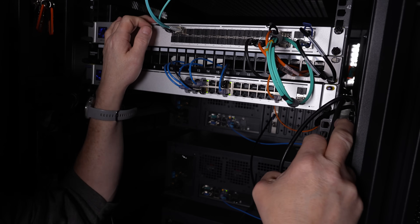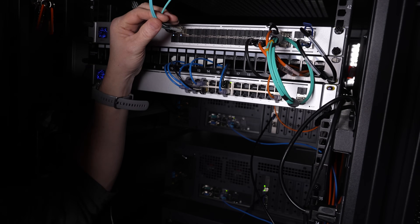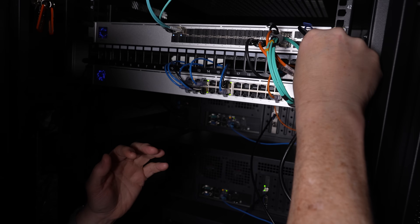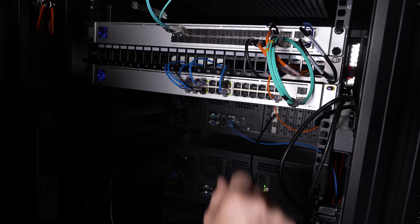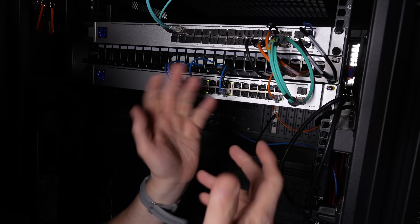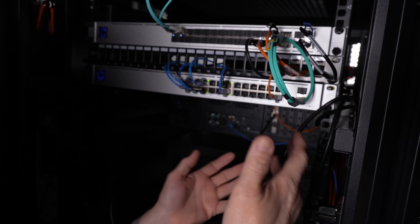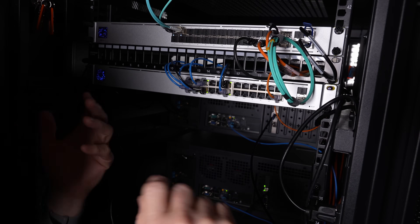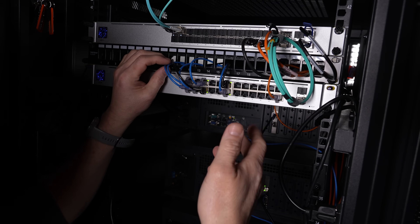This is the back of the enclosed rack with all the servers in it — fed by fiber from the other side, and it feeds another switch we'll get to next. This is a USW Pro aggregation switch, giving me a few 25-gig ports because those Ryzen servers all have 25-gig connections. I started doing some color coding — the DAC cables are orange, and I was using orange for storage. But I ran out of orange, so this black one also goes to some storage servers. So much for color coding, but DAC does come in different colors. There's nothing more permanent than a temporary solution.